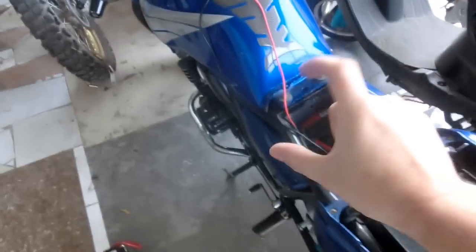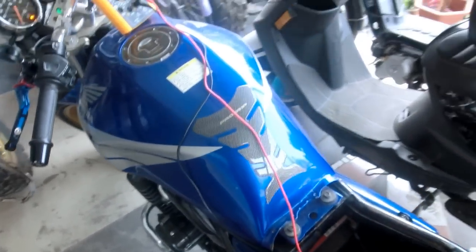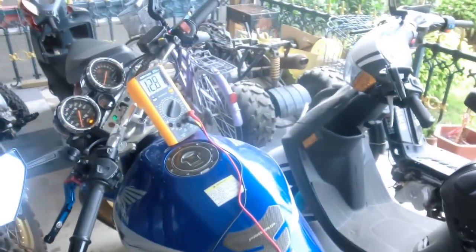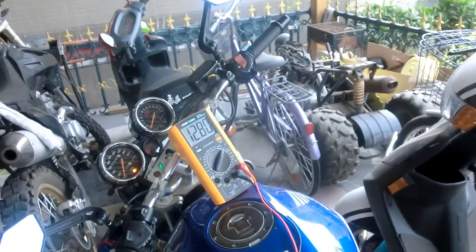Nothing wrong with the stator then. Turns out that the problem all along was that stupid thing I replaced — that main relay, that starter relay. So this whole time everything's been fine. You know what this means? That means there's basically nothing wrong with this bike now. But you know what this also means? It means I went and replaced the regulator and all this other crap for nothing. But it doesn't matter — I prefer having the newer parts in anyway. If your bike's not charging, I guess that's something you can check as well. Stupid, stupid, stupid little parts.